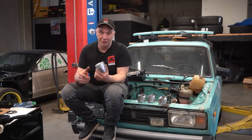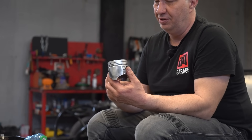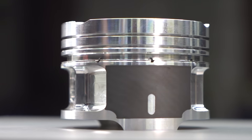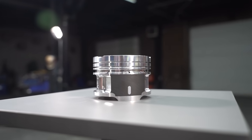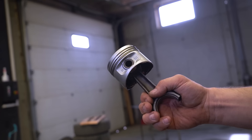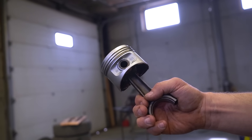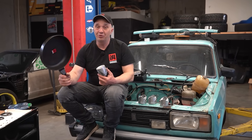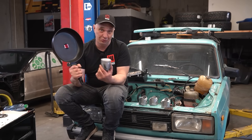I suggest we go into the theory. Anyone who has looked at a new piston has noticed that there's a coating — the materials are different, every company has its trade secrets. But most of the time they use a sort of Teflon paint. The idea is to help the pistons slip inside the cylinder. But we want to use the ubiquitous frying pan grade coating for our pistons.